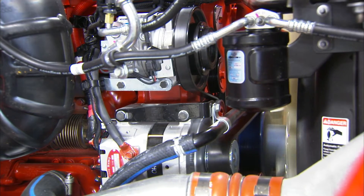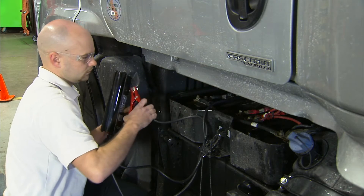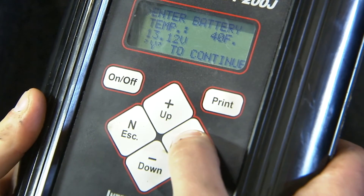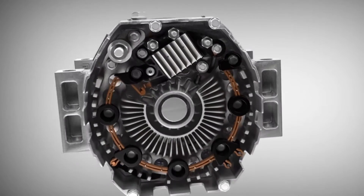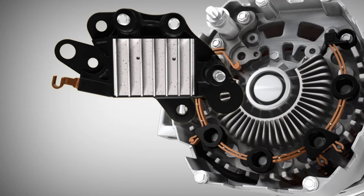The alternator has a second job that works in tandem with the first. You may hear people say that the alternator charges the batteries, but it's more accurate to say it maintains the batteries. When you start the vehicle it depletes some of the charge on the batteries; the alternator recovers that so the next time you shut the vehicle off you have enough juice to restart it. The alternator has what's called a regulator — think of it as the brains of the alternator. It senses the electrical load requirements and controls the amount of power distributed from the alternator to the batteries.